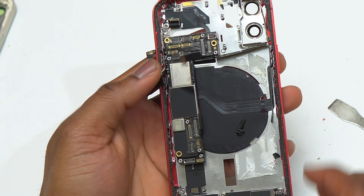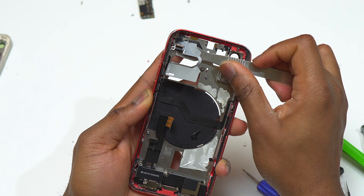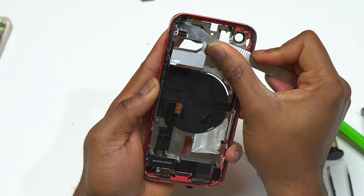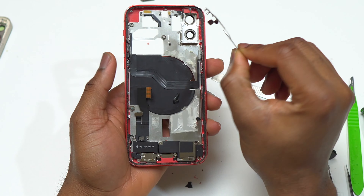Once the motherboard is no longer attached to the body and everything has been disconnected at the right, we can lift the motherboard entirely out. Apple is charging close to four hundred dollars for a back glass replacement — do you think it's worth it? Try this and let me know in the comments. Next, remove the component that was at the top of the motherboard — it has an extension that goes below. Apply a little heat around that area and pull slightly, as it is very fragile with a thin flex cable connection.